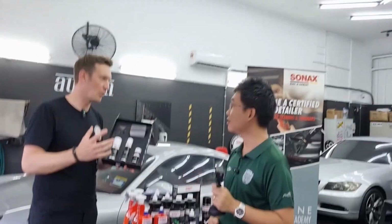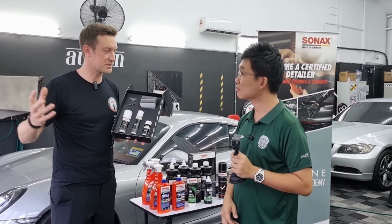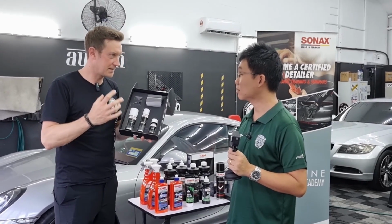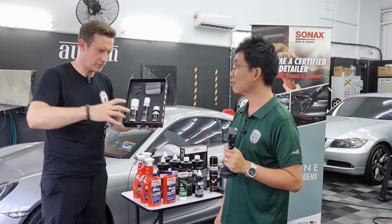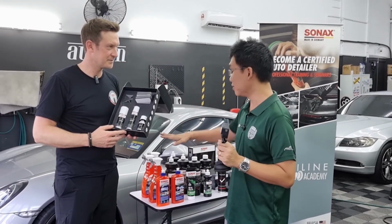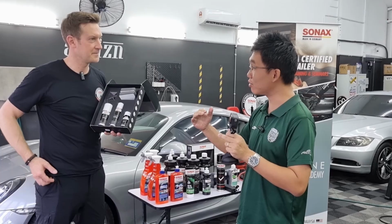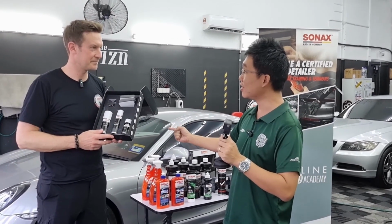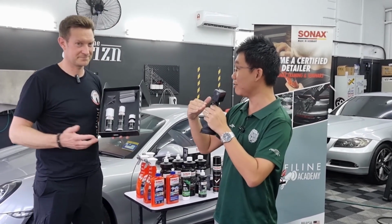And there is a good reason for it, because all the paint manufacturers and all the car producers, if the best protection would be a super hard coating, the clear coat, why don't they use it? Because the car is moving, the paint contracts and expands, so it should be flexible. It must actually, the metal bodywork expands and contracts. 100%. So your clear coat, your paint needs to expand and contract with the metal itself. If your hardness versus the metal is not compatible, you are creating friction.